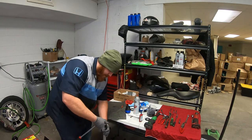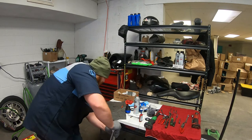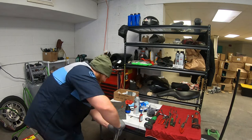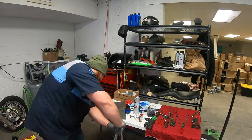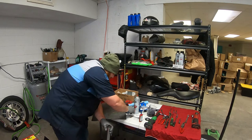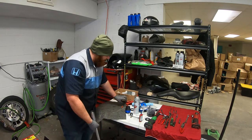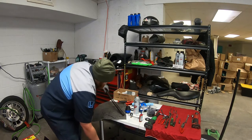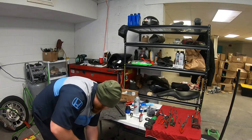While it's down there trying to do its thing, I'm gonna go ahead and take this off. I kind of lean it away from my face. I've already broke it free on the bike. One hand over top, this is under spring pressure. Spring pressure. It is under spring pressure. Herd-a-der. So, I'm not even gonna bother editing that out. Now that it can flow, it's draining a lot quicker. And I can already tell you the fluid that is coming out of this side looks far better than what came out of the other side. Pull the spring out, set that to the side. I'm gonna work this back and forth a few times so it can get anything that's left in there out.